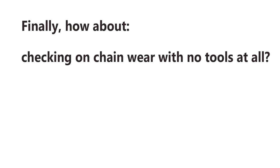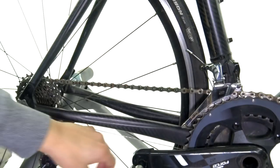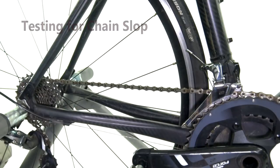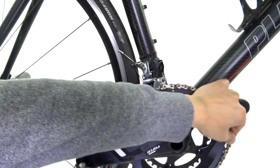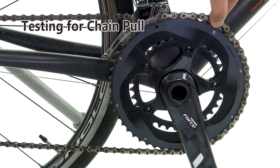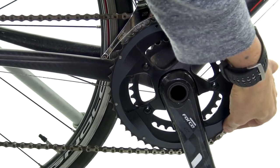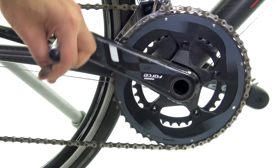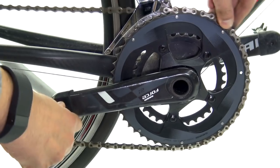One last thing then. What about those of you who say: I can't be bothered to buy the expensive gauge, I don't have a Park Tools manual gauge, I don't even have a ruler to hand — all I have is my hands and nothing else. Well, in that case the solution is to do that old mechanic's tip of testing for chain slop side to side. That implies the pins and the bushings are worn within the chain. If it's sloppy, like this chain, it's probably time to replace. Also do the old mechanic's tip of pulling the chain off the chainring whilst it's on. If it's as loose as this and you can see clear daylight, especially at the top of the tooth, then something's wrong. Rotate your cranks and see how well the chain is sitting on the crankset and chainring — if the chain is worn like this, you're going to get some gaps appearing, which is also bad.